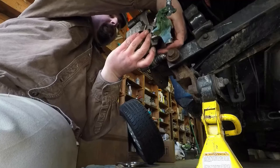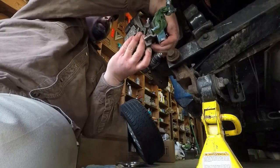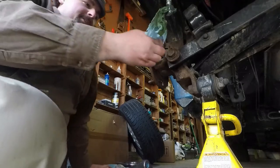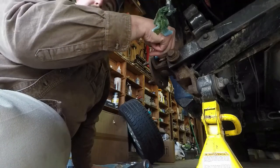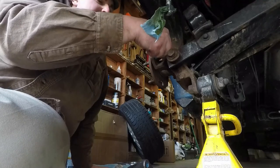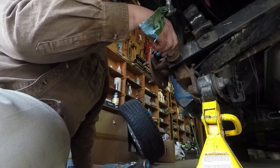So you got the brake line off, the soft line off, without stripping up the hard line. Yep. Good. The bolt isn't exactly a 12 millimeter anymore, but it still works with a 12 millimeter. It's like an 11.8, like 11.8 and 12.2.